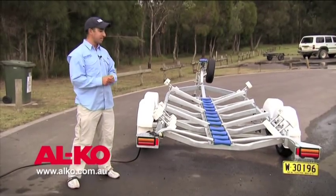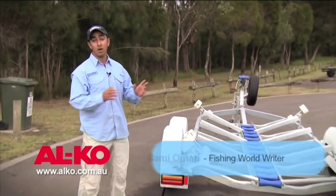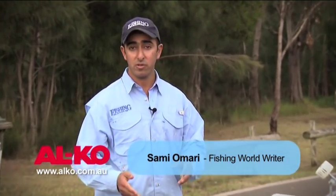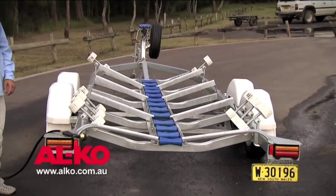Out of the boat, motor, and trailer package, the trailer probably has the hardest life of all. Trailers can sit idle for many weeks on end, they then travel long distances, the bearings and the hubs heat up, and then you reverse the trailer into the salt water and that cold harsh salt water quenches those hot elements.